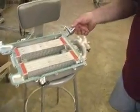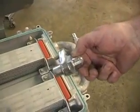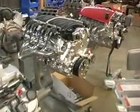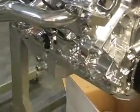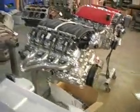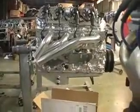These are the adapter fittings that we make for the LS7 for hooking up your oil lines to the trans. Here's an LS7 motor and it's got one of our custom pans on it that lets us put the LS7 into Chevelles, Camaros without changing the front crossmember. That motor is going into a '57 Chevy that we're doing the install on, which we'll get on the web. Notice how the pan is shaped, which gives us clearance for the crossmembers.